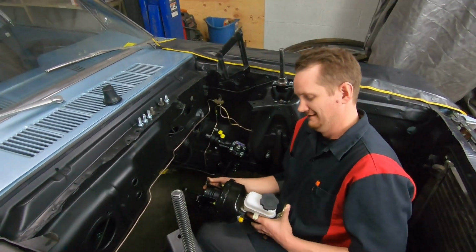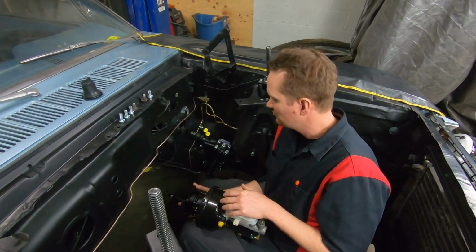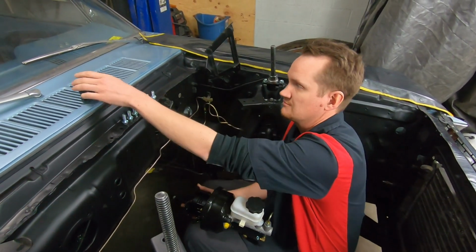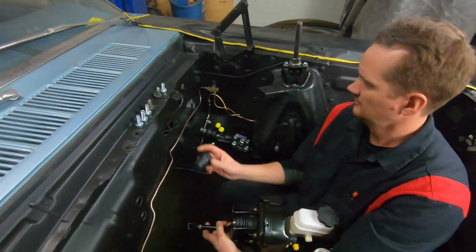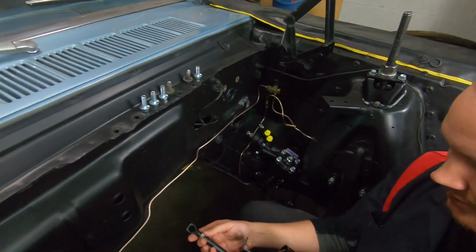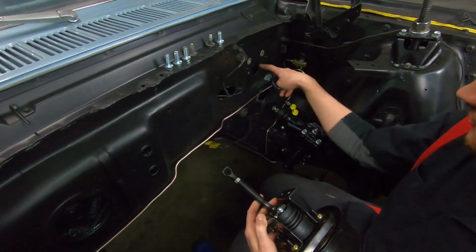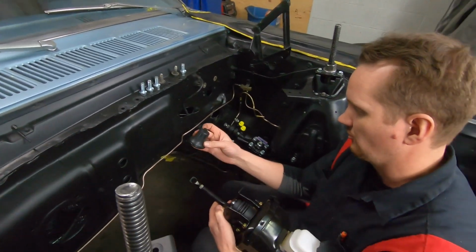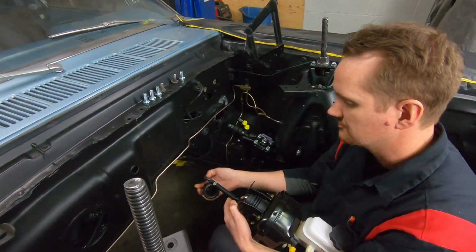So I was just installing this whole booster assembly, and this is probably the only thing that you are going to need to purchase separately, unless you already have one, because maybe your car was a factory power brake car. And it's this firewall seal that is going to go right here for your booster. The booster doesn't have one, so if you just install this, you're going to have this big gaping hole that just isn't really sealed. So it's probably a good idea to go ahead and purchase this, and I'll post a link in the description so you guys can see where to get it.